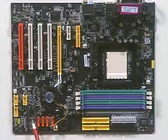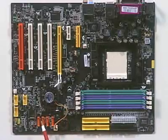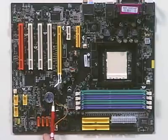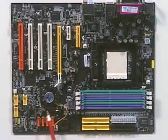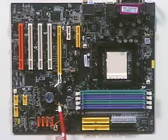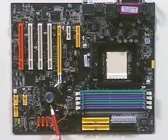In addition to our BIOS, we also have our chipset. Now, remember that the chipset is composed of the North Bridge and the South Bridge chipsets. On older systems, these were usually implemented as 2 separate chips. On a newer system, however, you might find both the North Bridge and the South Bridge incorporated into a single chip. Now, on this system, that single chip is beneath this fan. The chipset gets hot, so this particular system has implemented a fan to keep it cool.